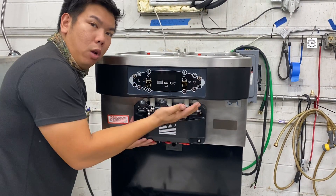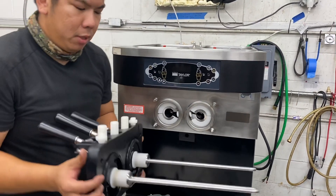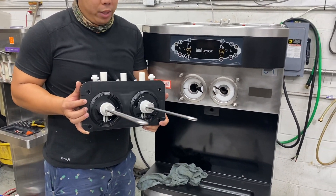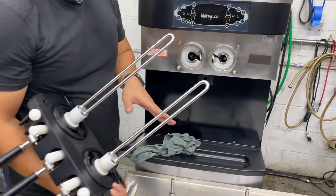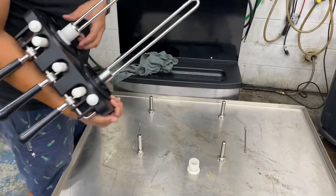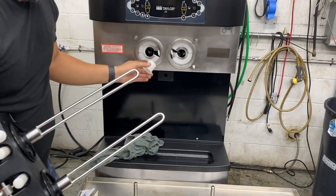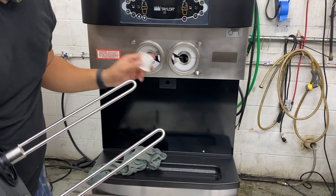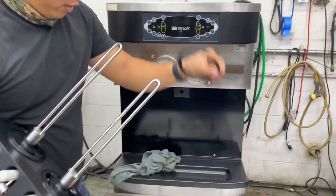We're going to pull off the door. This door assembly is a standard Crown Series C712/C713 door. We'll do the same deal — the slight difference with the pump machine is your plastic guides are going to be a little thinner, as they're physically fitting into a different auger or beater assembly. The pump-style assemblies always have these guides and different-style blades. These come off first, then you remove all your O-rings.